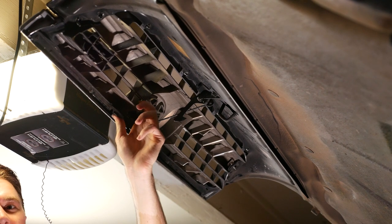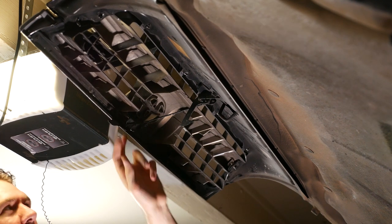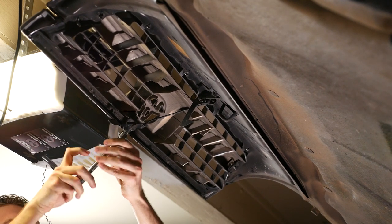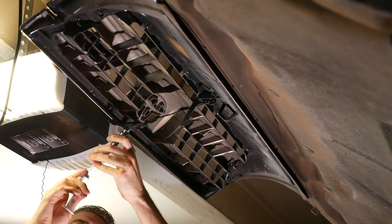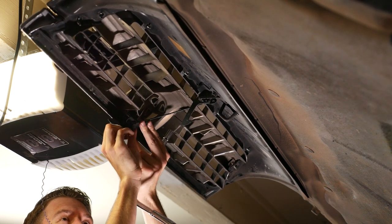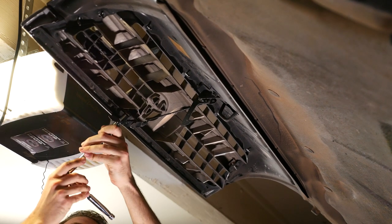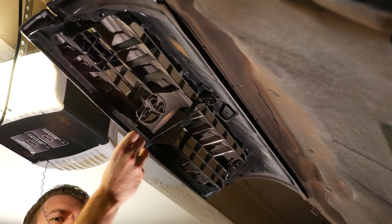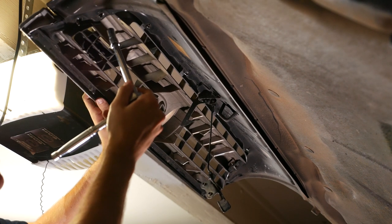The little mounting bracket for the hood release — there are a bunch of ways to take it off. There's one in the back and two over here; you can slide the rod off. I'm going to take the two off in the front — it's another two 10mm bolts. I left one of the acorn nuts on just so the grille doesn't fall while I'm taking this off. There it is — it just swings down out of your way.